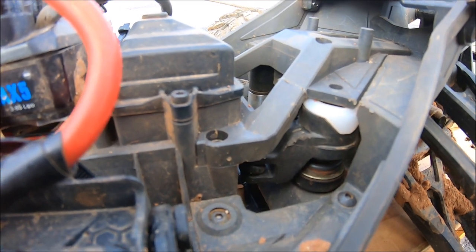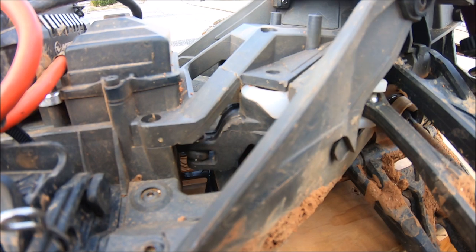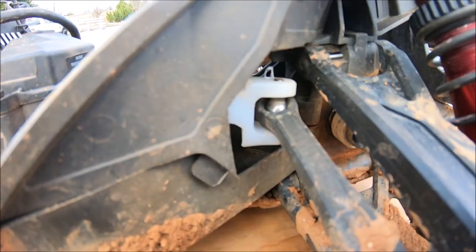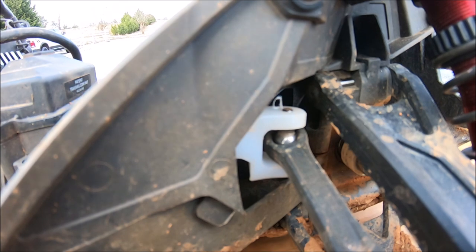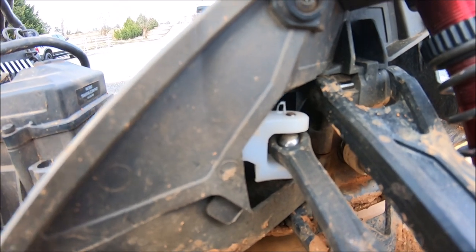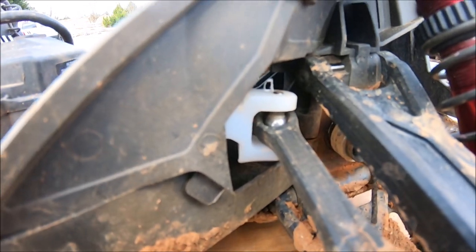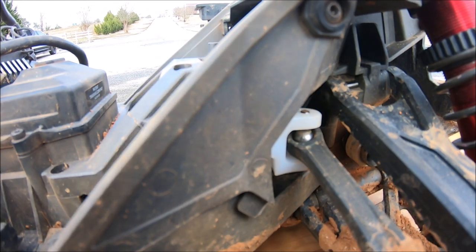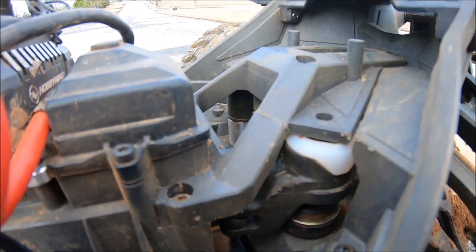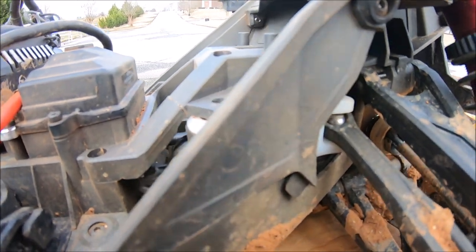The main test here is going to be this new M2C XR series bell crank. This is a non-aluminum bell crank — this is actually plastic, as you can see. We're testing different types of plastic, so this is very early in the testing phases, so please be patient with us. Because if you go with a big heavy bell crank, you're going to greatly jeopardize other parts of your steering components, your servo, servo horns and links and everything.